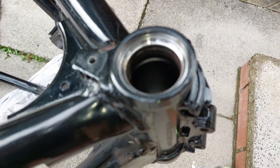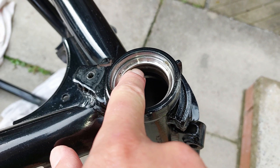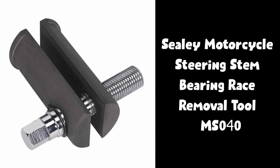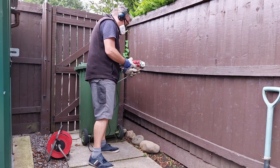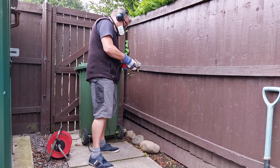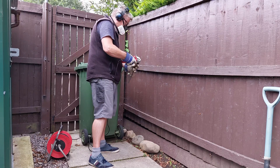The next thing to do was to get the bearing races out of the frame. I tried using various long tools to knock the race out, but I couldn't get any purchase on it. Some frames are easier, some frames are harder — this turned out to be a hard one. You could purchase a specific tool for this, but I didn't want to spend money on a tool I was only going to use once, so I made my own. I'm grinding away some material to create the lip that was on the commercial tool. One lip is better than no lips, so they say.